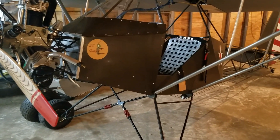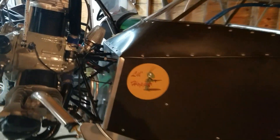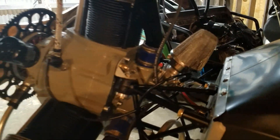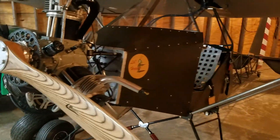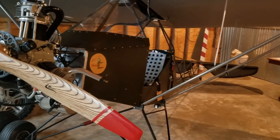Other than the tips, the other thing I'm going to do is a little repair job here. After three hours of engine run time, I've got a little crack starting to show up. My little tab there that mounts that to the engine is starting to form a crack. So we're going to remedy that by making some new brackets in a heavier gauge, get them TIG welded up, and get this thing back together.